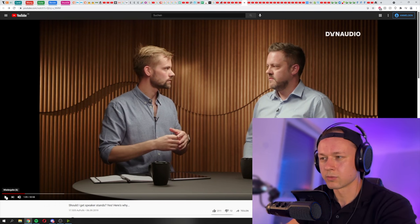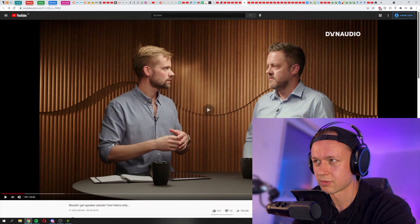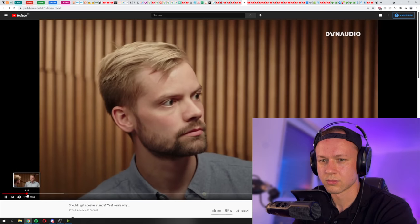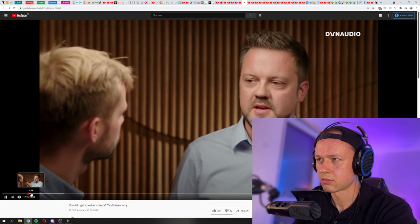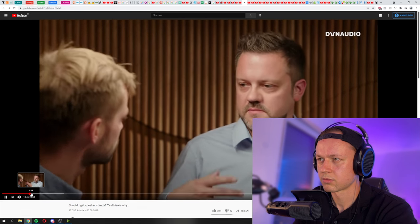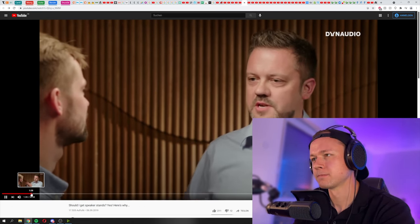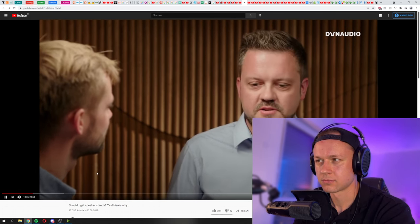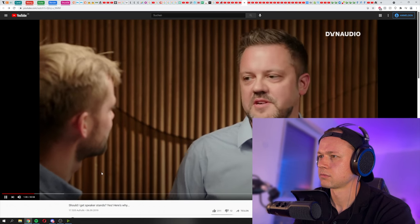and you get the freedom to position it any way you want, but I want to put it on the desk, so. But also, to get the right ear level, I assume? Yes, that's part of it. So to get the optimal sound, the speaker should be placed at a certain height, basically ear level. The distance between the speakers and the listening position matters to the sound. And again, especially the distance between the speaker and the walls makes a big difference to the sound. So that's actually the first step. Just having a stand makes a very big difference compared to not having a stand.